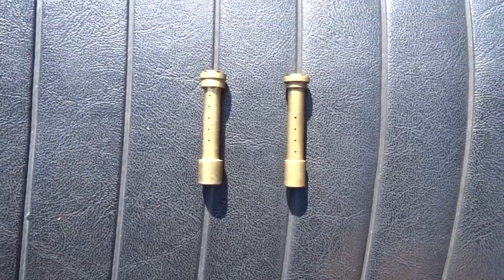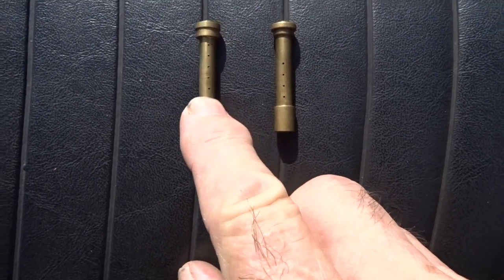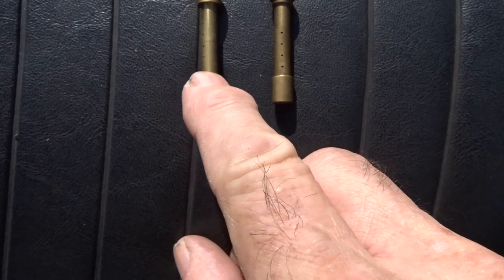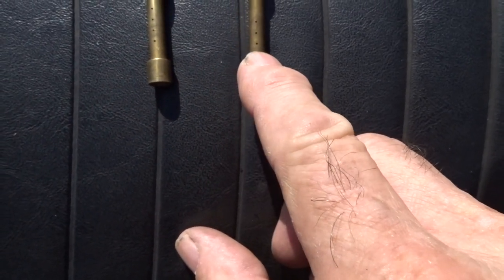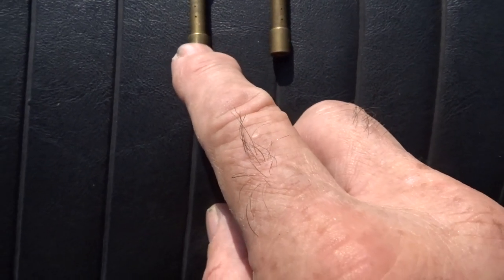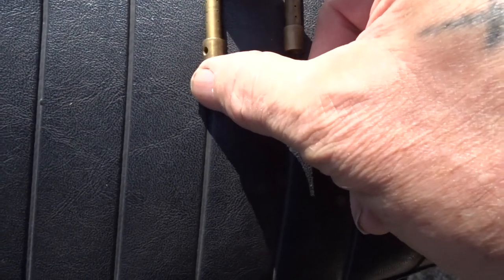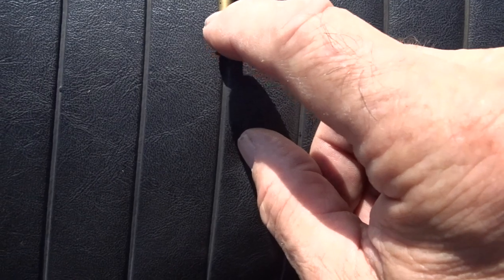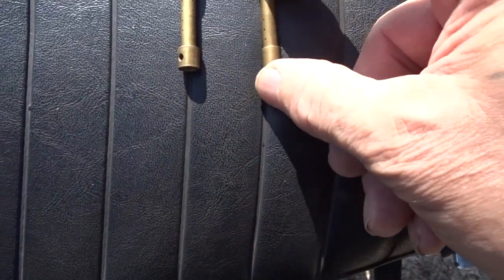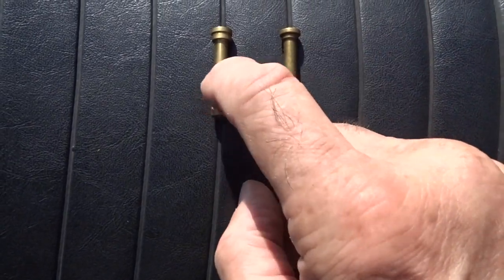This one on the left is the Canadian style, which has got five holes and four holes. And this is the original one, which has got four holes and three holes. So this is a 336Y-0 jet. The jet needle that goes with the Canadian one is the 5IX11, and the needle that goes with the three and four hole one is the 5HX12. So we want to put the Canadian style ones in.